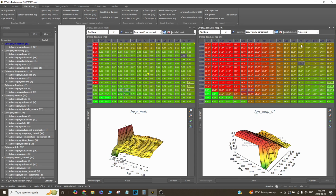So again, I run 1.5 bar on low boost. So these columns actually have less advance than I have on high boost. So I'm running a peak of around 17.5 degrees on low boost, and then a peak of 19 on high boost. And then, yes, this is the map that I ran most recently on the car at Mosport. So this really isn't a lot of timing, even 19 degrees on full boost. But again, I run this column all the way up to 40 pounds of boost. So once it hits 40 pounds, that's where it becomes a lot of timing.